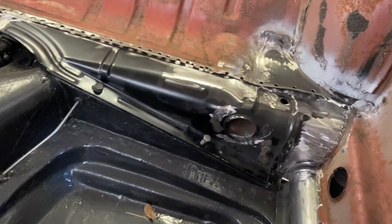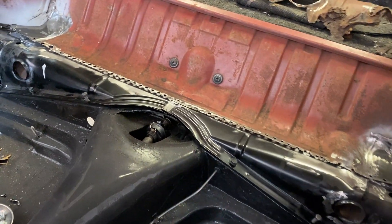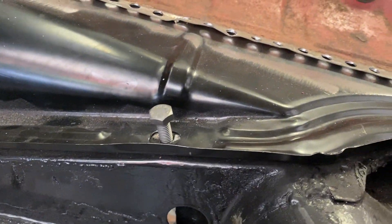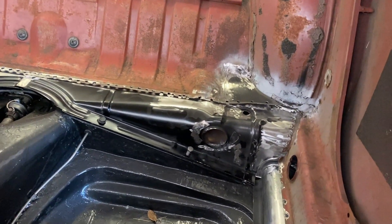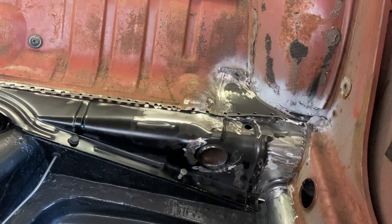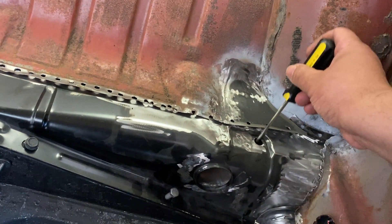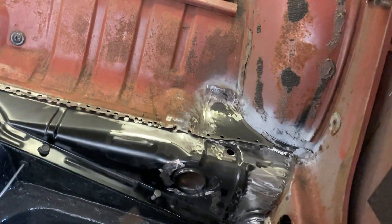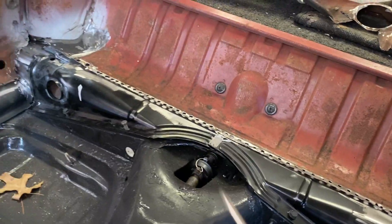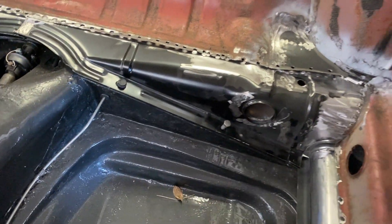You want to make sure your rear cross members are in. I have jacked it up all the way — everything is nice and tight. These all line up pretty good, as you can see. All looks good. We're going to tighten those down so this doesn't move anymore. But first, you want to make sure that this hole lines up into the chassis — just take a screwdriver gently, you can move it around. It's still loose, even though it's jacked up all the way, because this is all flimsy around here. Do the same thing on the other side. Once that's lined up, tighten these down to keep them in position.